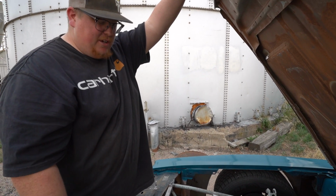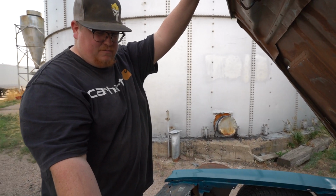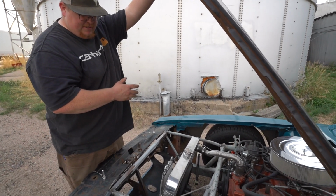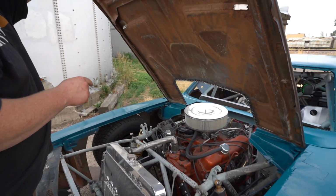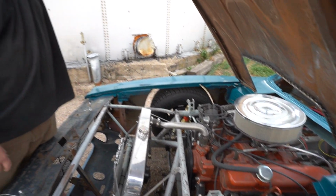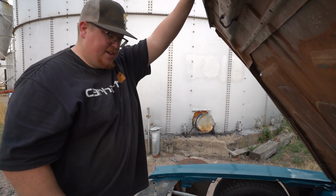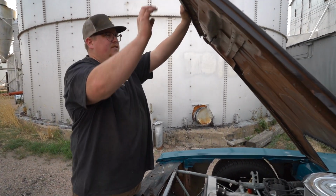So I got this one without motor and transmission, but that's the only thing that was missing. Everything else was still there. I don't really know much about it. I'm on a crash course learning about these race car parts. Like I said, Wilwood disc brakes, the rotors bolt onto the hubs. Really expensive stuff, cool, I really don't know a whole lot about it. Being part of the race car as well, the motor is set back super far, and one of the reasons I did that was for weight transfer. And this thing, as it sits, I need to buy some springs and shocks and even this thing out. It's still suspension-wise set up for going left. I've straightened out the front end so that at least the wheels are somewhat straight, but still got to work on that.